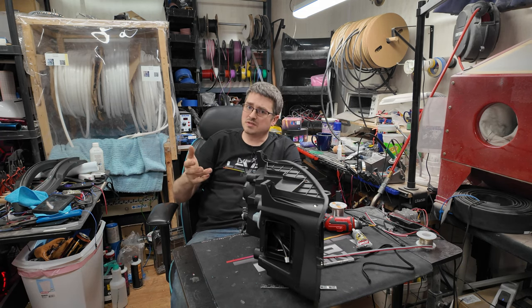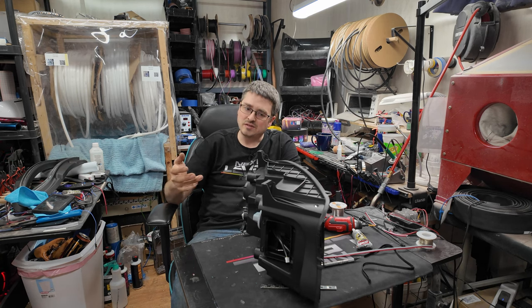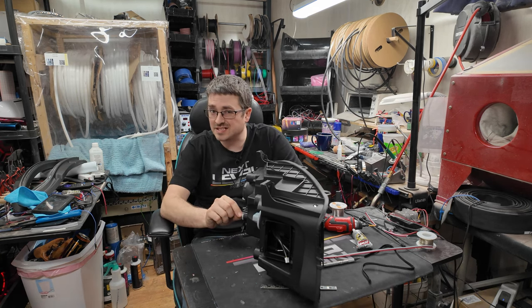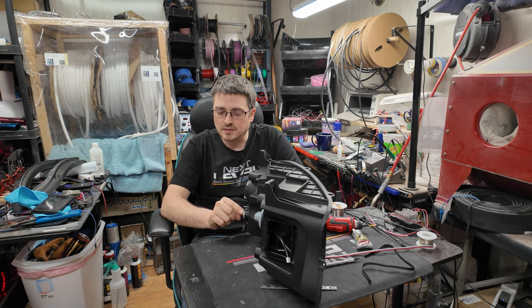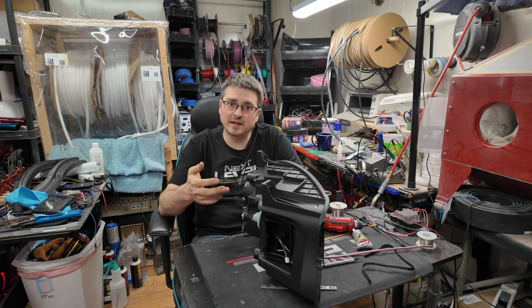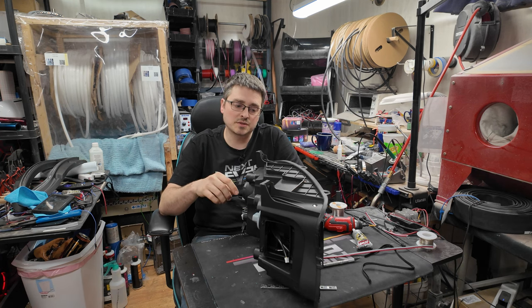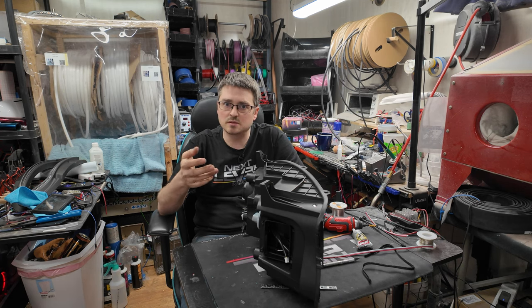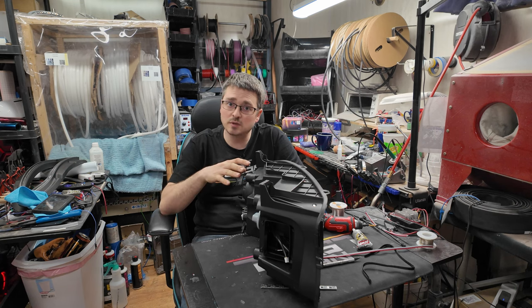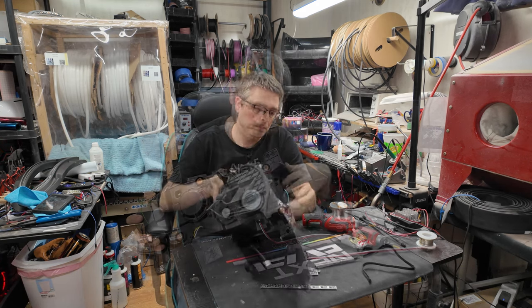And then as with just about any kind of set that you buy online or you install on a car, they do generally need to be adjusted slightly on the bottom adjustment screw here in order to get the proper alignment. That is pretty normal if you buy a light from anywhere. They will usually be close, but almost never are gonna be perfect. So definitely make sure anybody that's buying these from you knows, or in the case that you're doing it yourself, you are prepared for that.